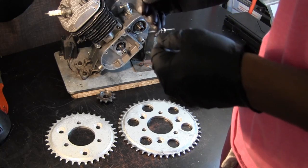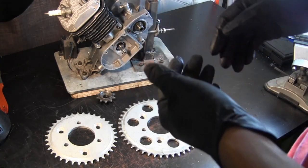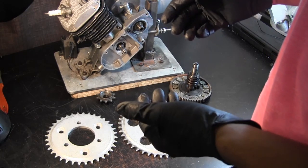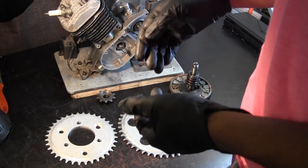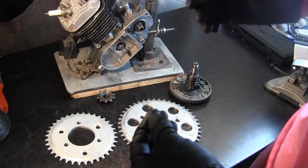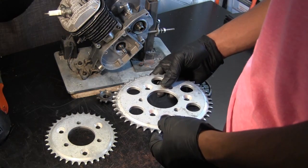For our personal bikes and some of our customers, we get standard riders who are in an urban, traditionally flat area. In that case, it makes more sense to opt for something with a higher top speed because you'll be cruising on flat ground and you don't really need the torque associated with a 44-tooth sprocket.